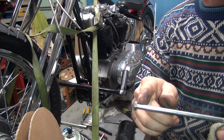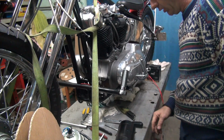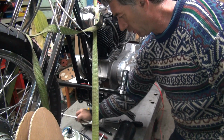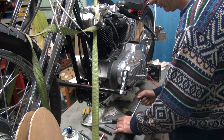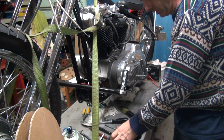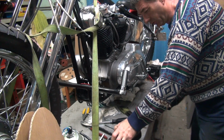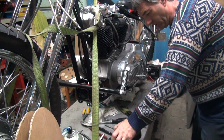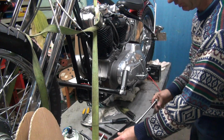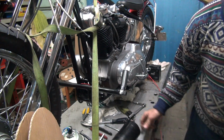The correct bolt has knurls right here that are larger diameter, so when you push in the body of the generator it stays put. You take the bolt in and out. So we'll go ahead and take this out. Change the bolt. You just happen to have the correct one on the other hole that we need, so we'll just flip this around. So this one will stay where it's supposed to be, and the other one will spin, which won't matter because I'll tighten it up. Okay, that one's free. And we'll use a hammer to knock that out.